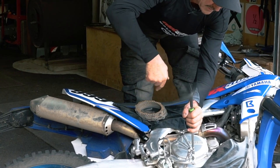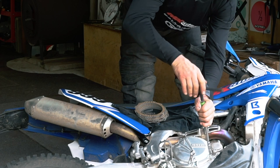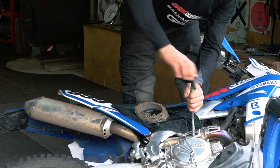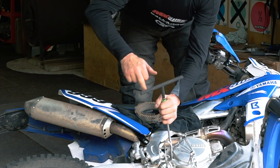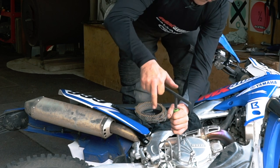There's a series of bolts — in most cases on Japanese bikes they're using 8mm bolts. With a spinning T-bar or a little battery drill you can get the cover off pretty quickly — that's the first thing.